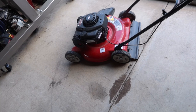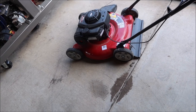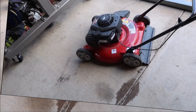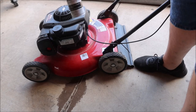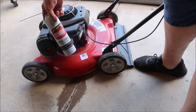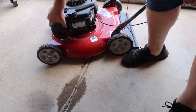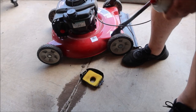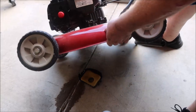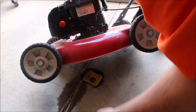So I'm going to go over the steps I use to diagnose a no-start on a basic single cylinder push mower. My favorite tool in the whole toolbox when diagnosing these small engines is just a can of carb spray. What I'm going to do is take the air filter off, then spray right into the throat of the carburetor — just a little bit, you don't need much.